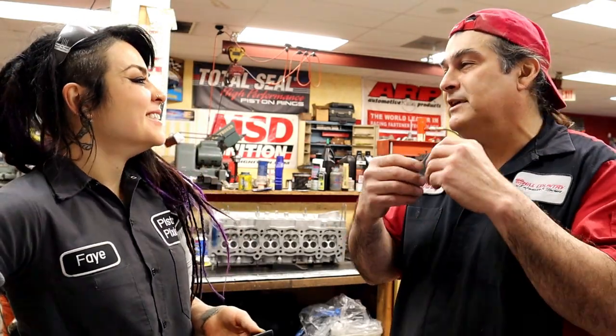Question from Christopher Baker: do you do heads for the older Mercedes-Benz diesel engines? Danny: The older Mercedes — I told you before, those were the first aluminum heads we ever saw. That was one of the first aluminum heads coming into the shop. People were doing the same procedures for a cast iron head on an aluminum head. That's when you had to learn; you kind of pioneered it because you can't use the same procedures. Everybody was dropping seats because they were using the same interference fit as a cast iron head — aluminum is going to expand roughly twice the rate.